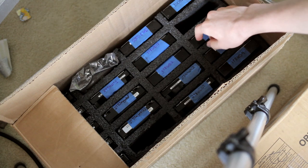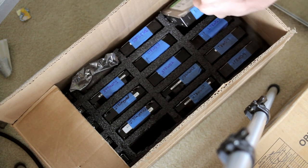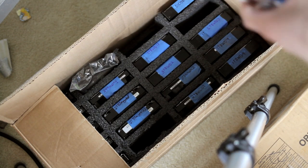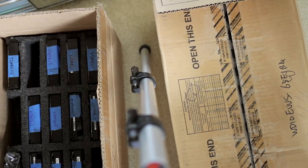I'm going to start pulling out some drives. I pulled out a 500 gig Seagate, here's another green power drive — a 500 gig WD. I have no idea where this guy's from but let's pull him in. I think the 2TB drives will work, but I can't use the 3TB drives because there's a 2TiB limit in the system.